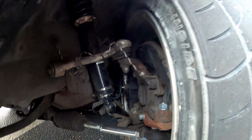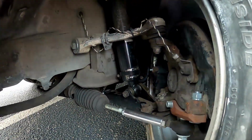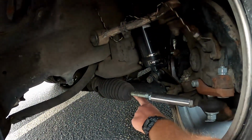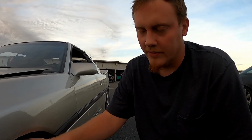And stock upper and lower control arms? Yep, stock uppers and then the Agile Performance lowers. They got Heim joints down there, so you can get pretty good camber out of them. Now, the updated ones they have, you can get a lot more camber out of them. And they also make an upper arm too now. I got this kit maybe 2-3 years ago.